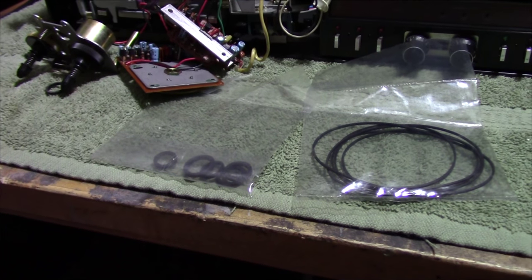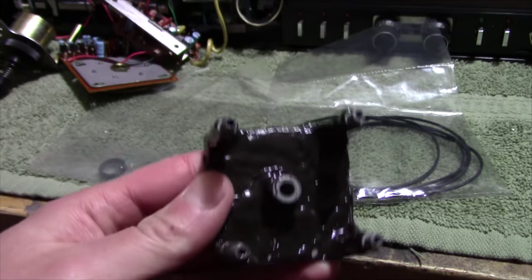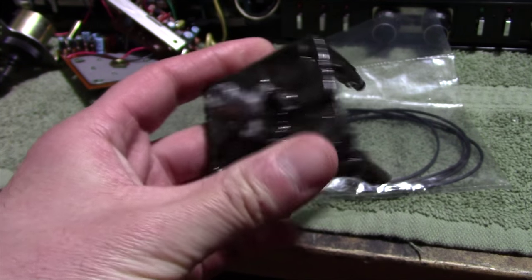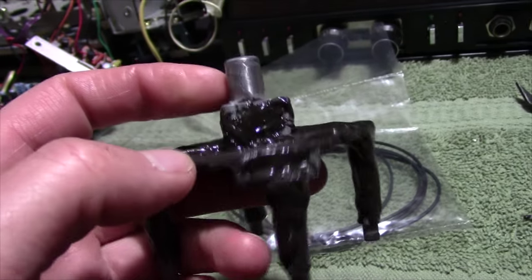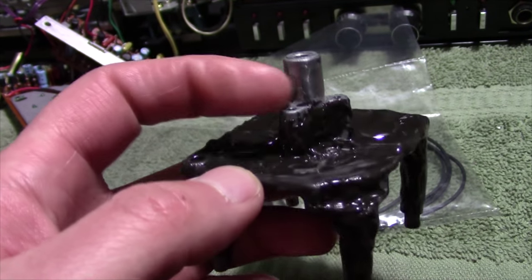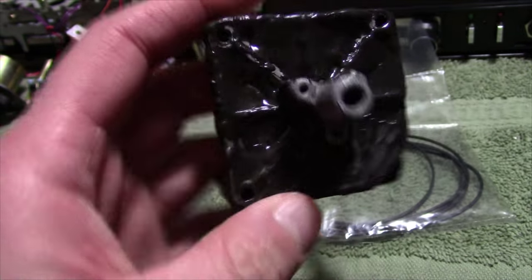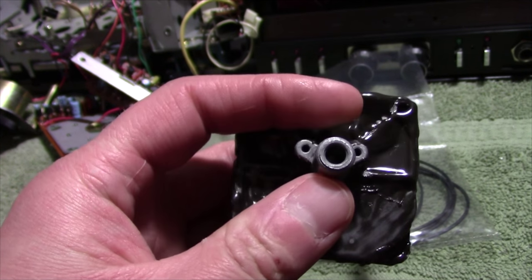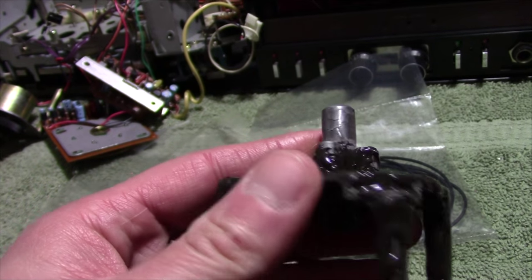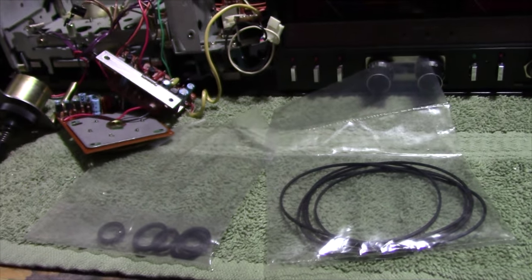About a week and a half later, parts finally arrived for this Fischer cassette deck. The bracket that holds the capstan motor is pretty much finished — not the prettiest thing in the world, but it'll definitely hold. I went ahead and sanded it down a little to make it smoother so it fits better through the hole. I'm going to smear some liquid super glue around there to soak in and help hold that metal together. I can't put any JB weld on the snout because that would change its diameter and it wouldn't fit in the hole anymore.